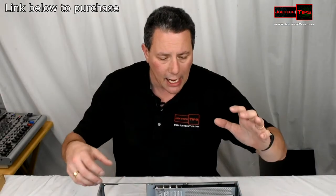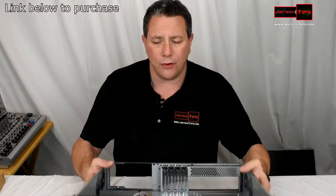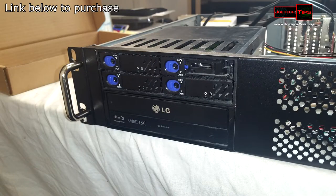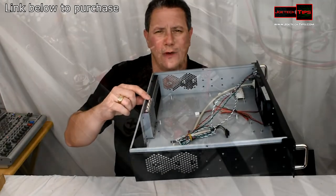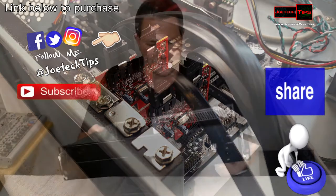This is a really nice chassis. I was very picky because I needed to have 5.25-inch bays — I have four 2.5-inch drives in a chassis and a Blu-ray drive which I burn all my files to, because it is a backup server. The 2U size is perfect for this task because I have low profile brackets from my RAID cards.